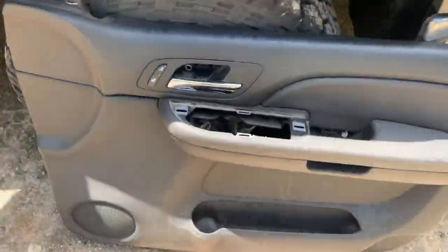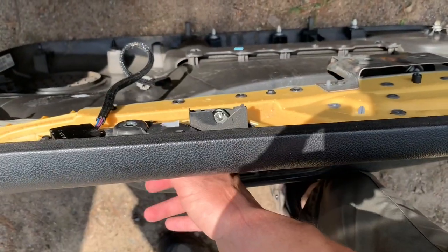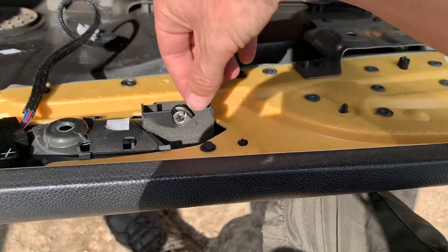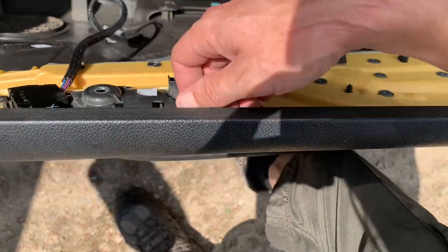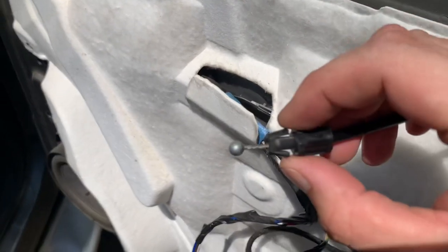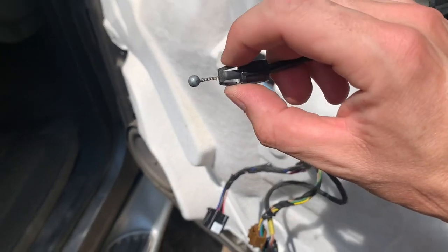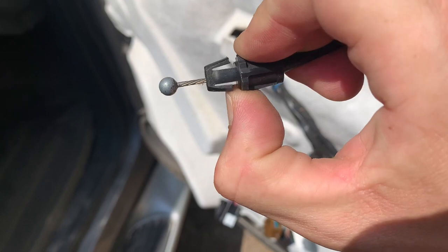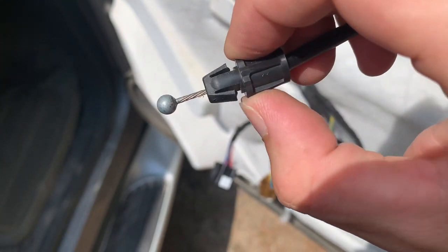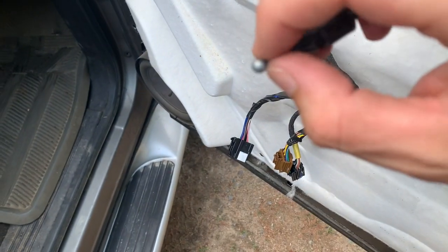That's why you have to undo this here, because it'll lift up like that — up, up and away. I had to undo the actual interior door handle. I think they're known for handles and cables on these trucks. There's a two-stage release: you squish the case and release it first, then pull up on the center ball. You squeeze these together and the case will pull out — it rotates in there too. I usually squeeze one side, cant it, then squeeze the other side and pull it, and then the ball just comes straight up.